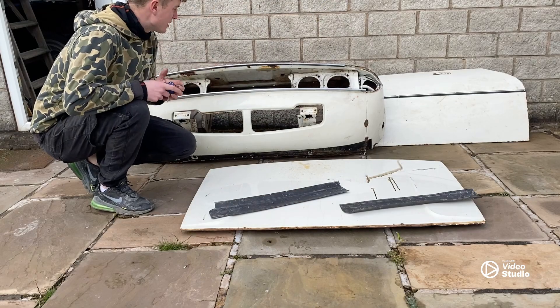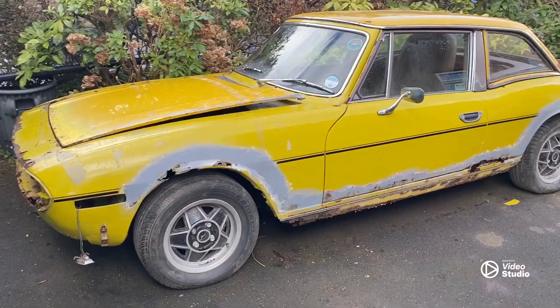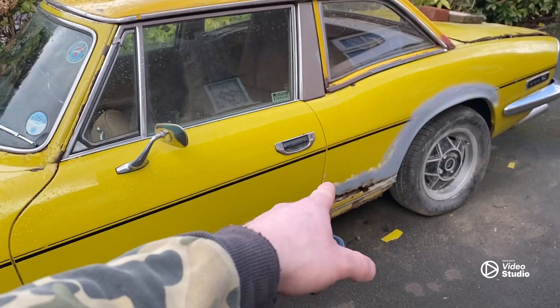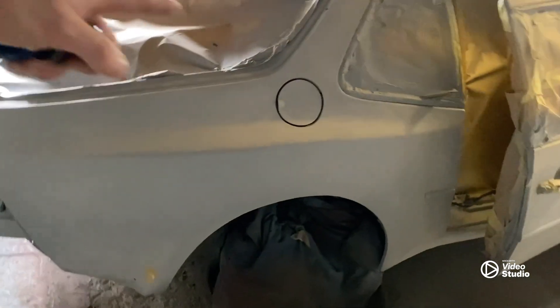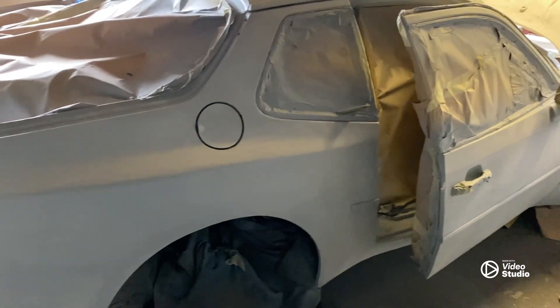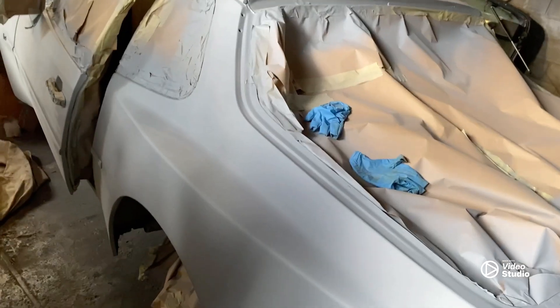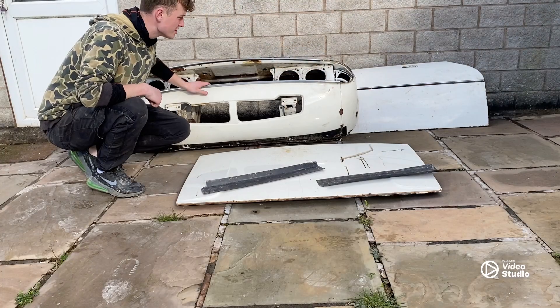I'm back from Wrexham, just picking up these panels now. First, an update on what's going on in the garage. Unfortunately the Stag's back outside — I've just put some zinc primer over some of the rust to slow down the rusting. The 944 is here in primer, right in the middle of the garage, which is why the Stag had to go back outside. I didn't plan for it to be in there this long, but the weather went really cold — it needs minimum 13 degrees to spray 2K top coat. We'll have a video soon of the whole painting process.